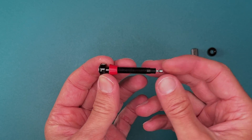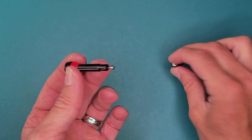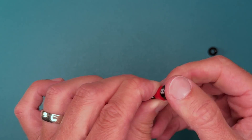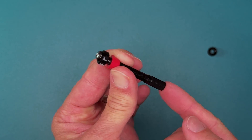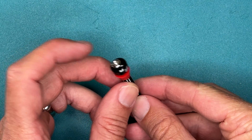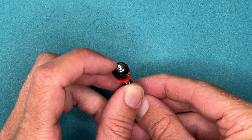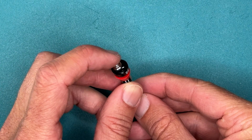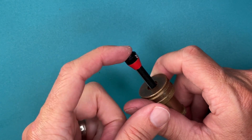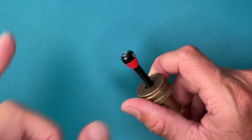Technically, the caps aren't required, but given the design, it seems wise to use the caps to lock them shut. Anyway, as I started clogging my traditional valves, I decided it was time to try out the Fillmore's. Inside, you can see a pin running side to side that holds the poppet valve in place. It can slide left to right along this pin, but you can't remove it. You can see how the pressure from pumping forces the valve open — with back pressure from inside the tire, it would auto-close.